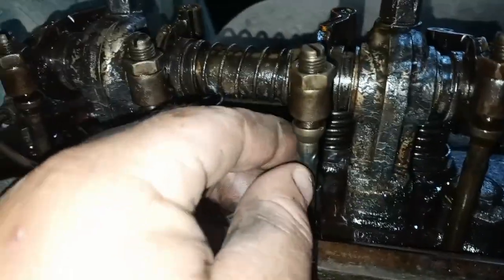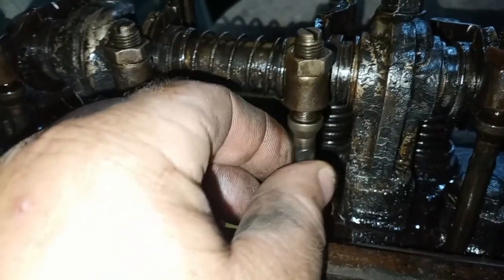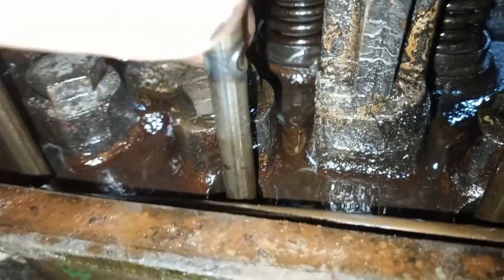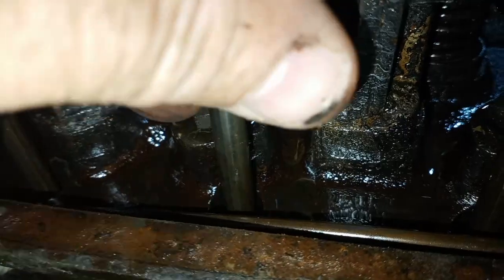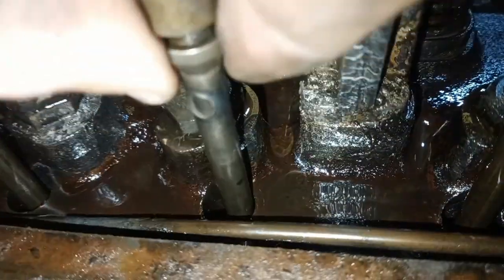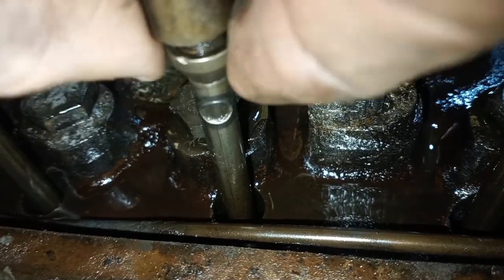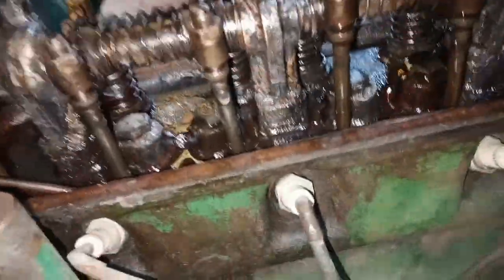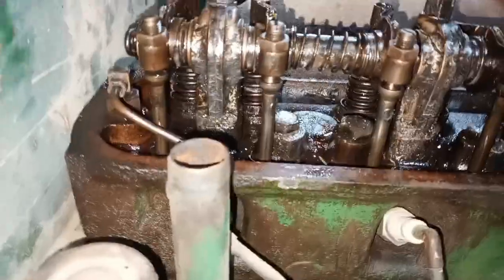Using my phone now because both the GoPros are dead. But here's this, the bent valve, or not the bent valve, the stuck valve. See how well you can see it. But the push rod popped out of place and now she's bent. Watch it in the hole there as I hold the thing down. It orbits around. I've got another push rod, but now I gotta pull the whole valve train up just to switch that one push rod. So, see?